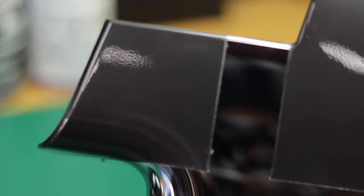I think the 2k clear will help resist fading and chipping with that thick layer on top. However, applying Shadow Chrome is still a bit of a challenge — I highly recommend practicing on a test piece first. Shadow Chrome is a little thin and I hung the parts vertically, which caused it to leak down to the edges and get thicker where gravity took it. Maybe spray it and then lay it down flat so it spreads more evenly and you don't get inconsistent sections.